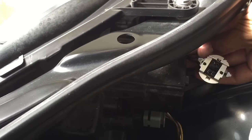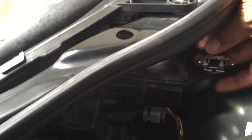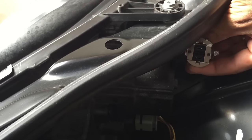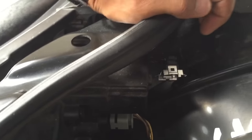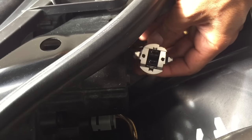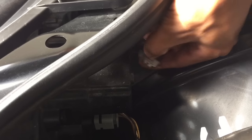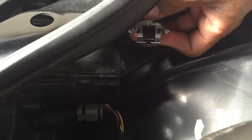It's gonna be attached to this device right here. I use a screwdriver and I just pry the bottom sides of it to get the bulb out of this piece right here. Now when you get your hand on the inside to get this piece off, you have to spin it counterclockwise. It's gonna be a little fiddly, but when you get your hand in there you feel it. You spin it counterclockwise and that brings the whole bulb out.